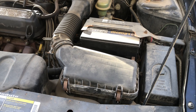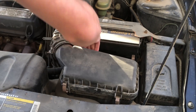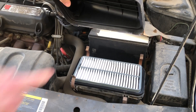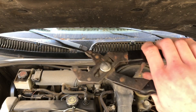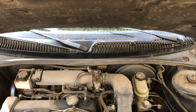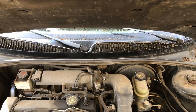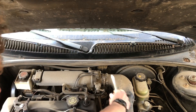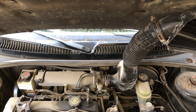First we're going to need to move this air intake tube, so just pop all of them off. That's where the filter is — we don't need to touch that. Now this clip up here is pretty annoying, but there's a way to do it. You need some sort of clamping tool, then come in between here with something else and push it in until it clicks. Now it's loose. You'll want to remove this hose, wiggle it a little bit, then rotate this out. You don't need to take it out all the way, just lift it up and out of the way.